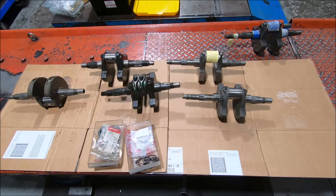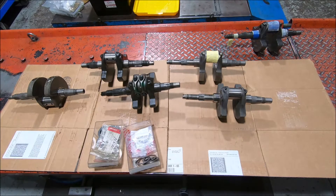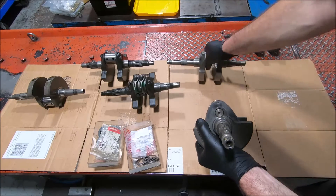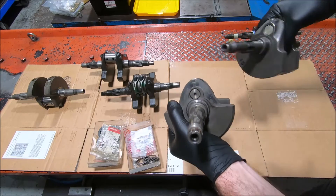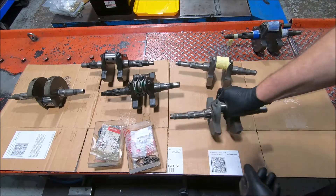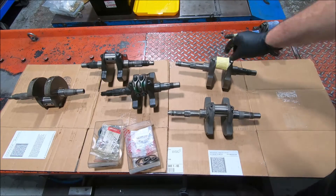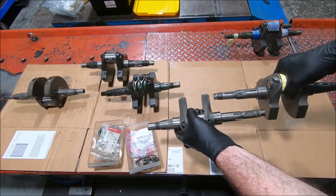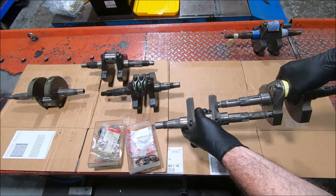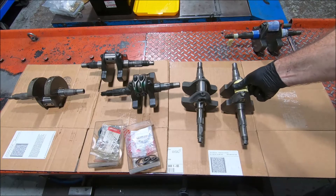I have thought about grinding one of the 900 cranks down to 40mm, but I have some concern that if you grind one of these down to 40mm it might end up with not enough wall thickness. But the idea is that way you could put one of these cranks - which in terms of length on the alternator side would fit - into an early small block with the small block rods.